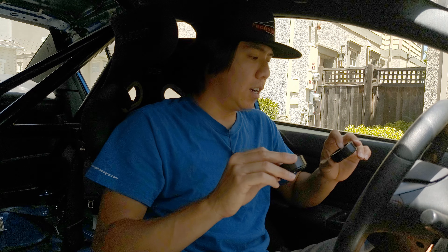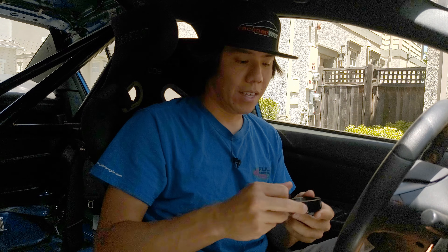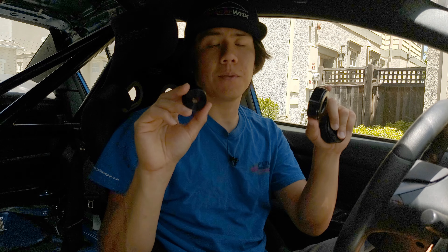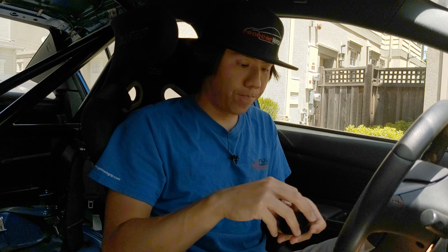The install itself is very easy — it should be as simple as removing two bolts, sliding these pieces in, and tightening the bolts down. The idea behind these bushings is that there's a rather large void inside the differential bushing, that this urethane bushing fills, and then this metallic or aluminum washer fills into the void of the urethane bushing, and then the nut clamps down. That makes the bushing a lot more solid — there's no longer a void, so it can't flex as much.